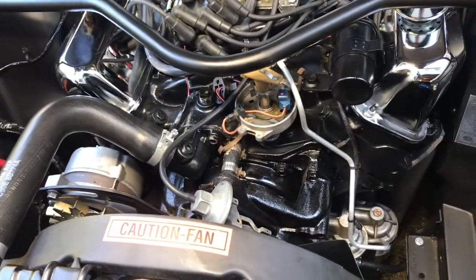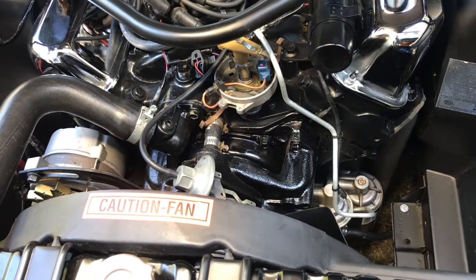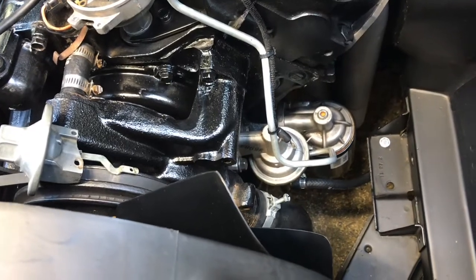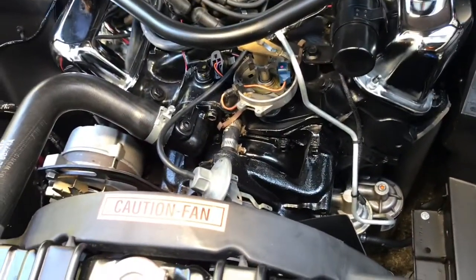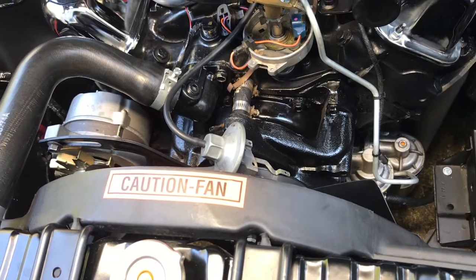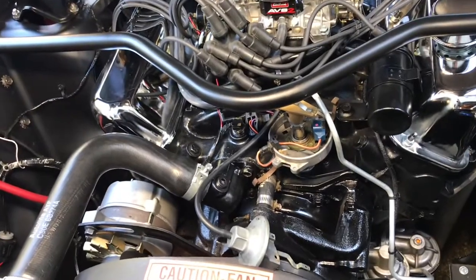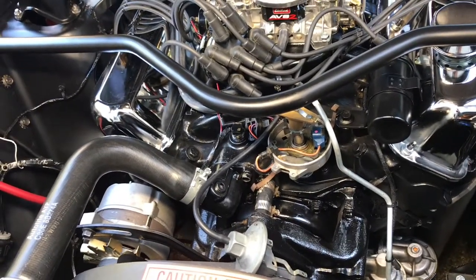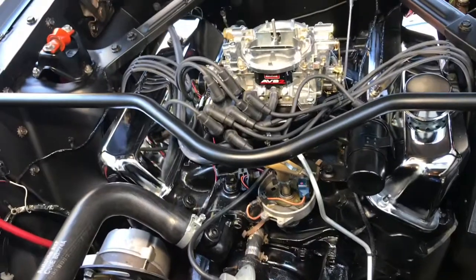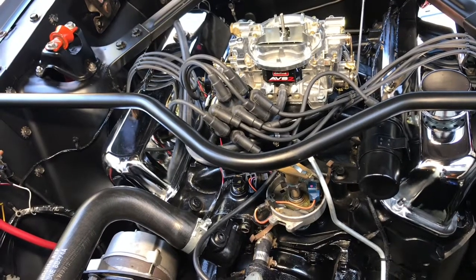Without a timing light I tried to diagnose what was wrong. I noticed the timing chain was kind of sloppy when I felt through the mechanical fuel pump opening, so I replaced it - but the car did exactly the same thing. A couple weeks later I disconnected the vacuum advance, and driving up the hill it popped and spit at a much lower RPM, which helped me diagnose it as timing-related.